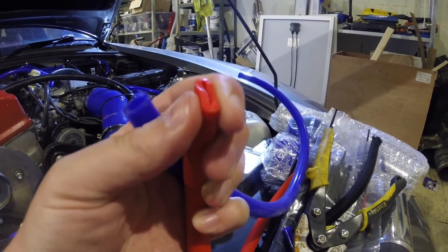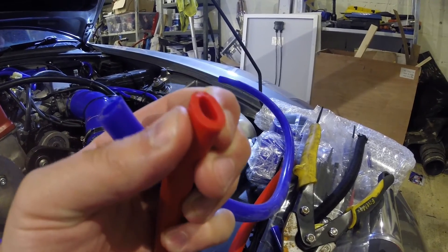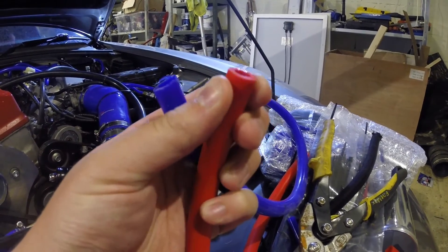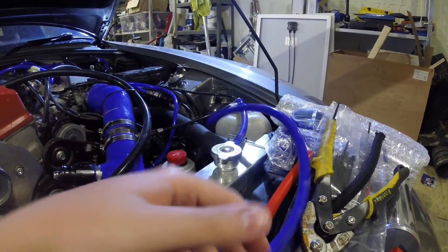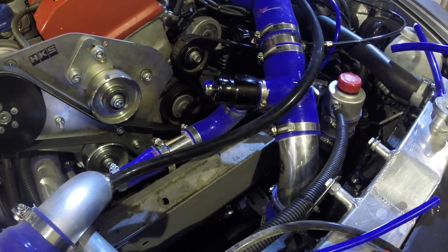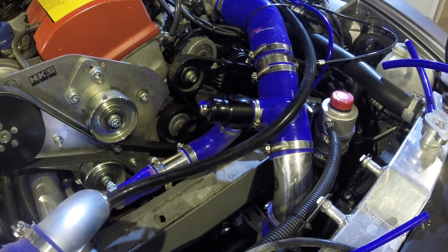This one is very difficult - that's about as far as I can get it with thumb pressure. Imagine when you're driving, you're getting a vacuum on that cheap line - it's just getting sucked inwards and you'll probably get to the point where you're not getting full vacuum because the bore of the pipe is being pulled smaller. So yeah, definitely spend the money on some good vacuum hoses. Thanks for watching, make sure you subscribe to our videos and hopefully I'll post some more about my Honda S2000 soon.